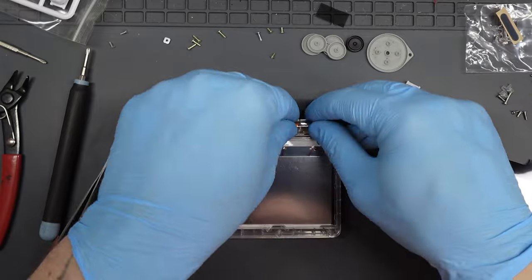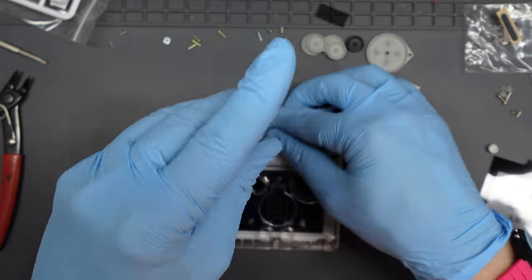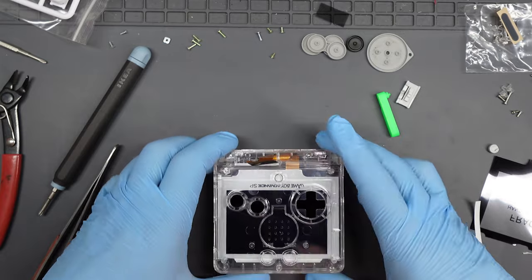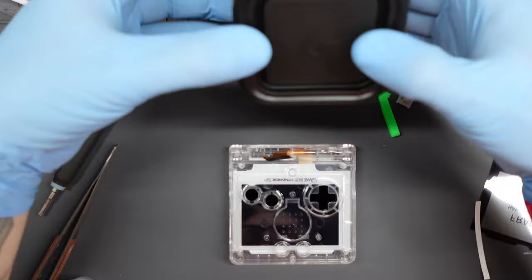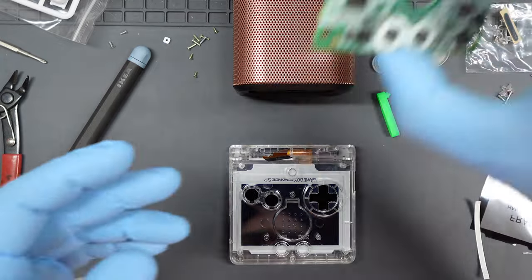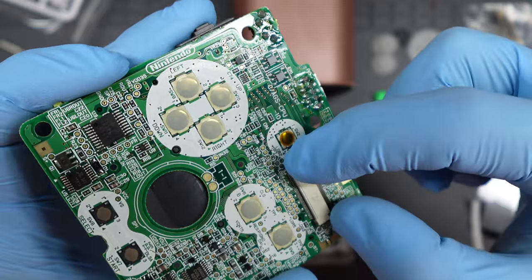After the screen, close the hinge, put the cap over the ribbon, flip it over, lift up the end of the ribbon, and use one of the long cross-head screws to hold that in position. Attaching the ribbon to the motherboard is quite tricky, so address that next. It's good to have something to support the motherboard — I used a small Bluetooth speaker, but any small weighted box will do.